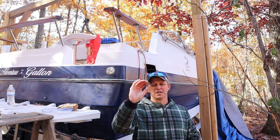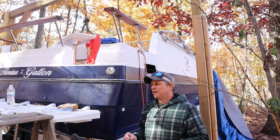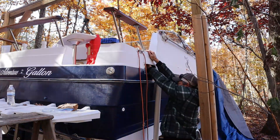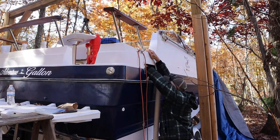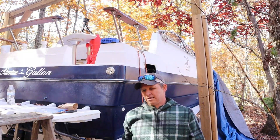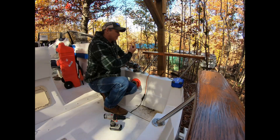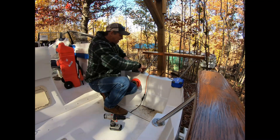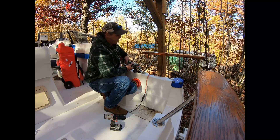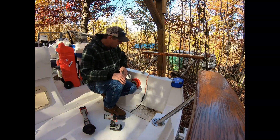The good thing is I do have these big washers, and where I drilled down is on the edge of the plate that's already there. So putting this washer and nut on should pull that plate back up, and it's big enough to cover the hole that I drilled. The problem is do I have enough to get this to bite? I tried to run this bolt in to pull the plate up so I could get the nut on, but I don't know if the nut stripped or what happened — I can't get it out.